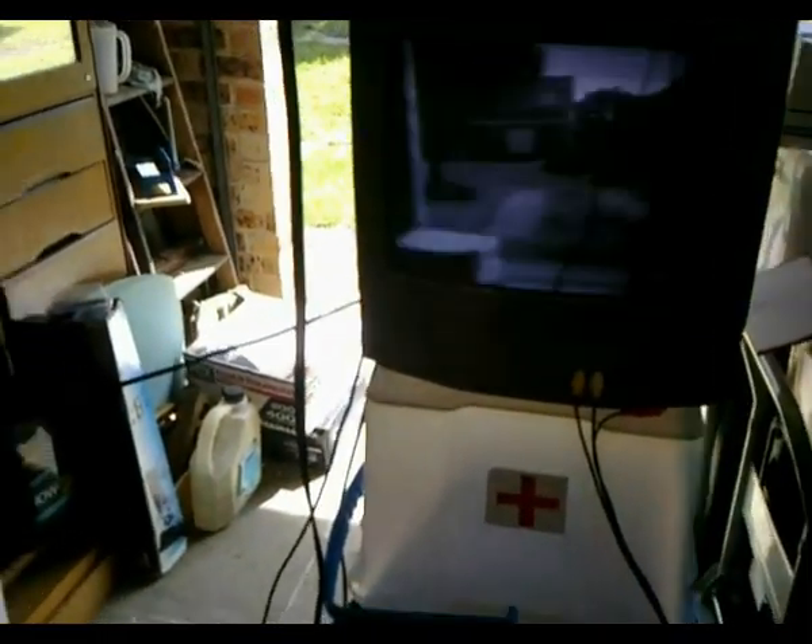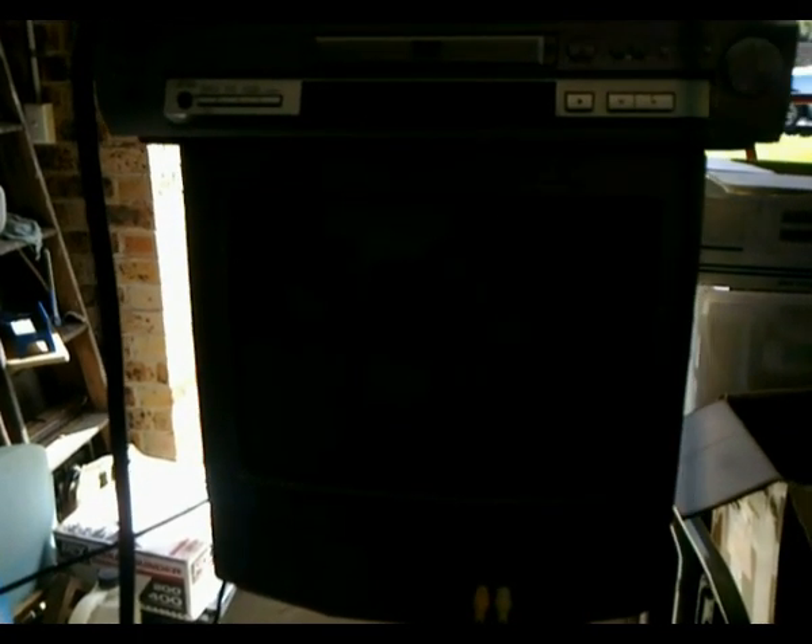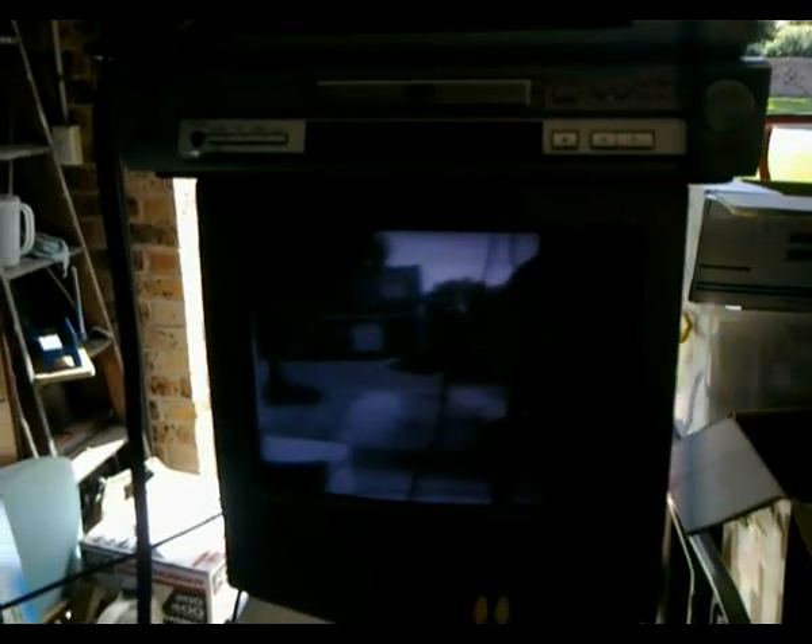All hooked up and everything, it's making quite a nice picture. The picture's actually dark because I've got it hooked through my VCR to the TV and the VCR strips the DC component in the video and I lose a lot of luminance. Either way, it's making a much more vertically stable picture and I can now actually record to videotape and DVD recorder without any picture problems such as frame droppage or other weird artifacts.